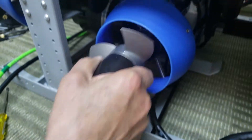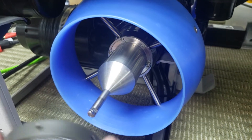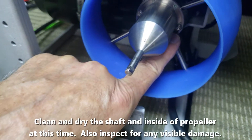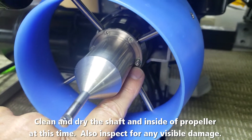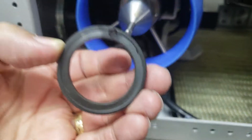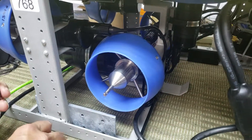Pull the prop off. Pull the inside water bearing and spring. Inside the prop you can see a nut that's protruding out where the other ones aren't — that's for setting into this hole. It keeps the water bearing from rotating.